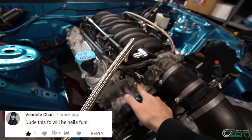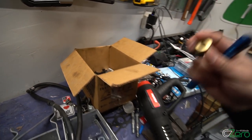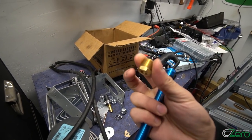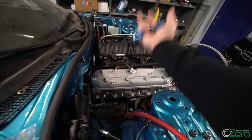Another thing I did was install an aftermarket water temperature sensor here, which will run the signal to the Speedhut gauges instead of the original location. I had a little disaster with this — to install a temperature sender you use a small adapter to go from an NPT fitting to the M15 or whatever the GM head uses. My problem was when I did that, the adapter literally broke in half inside the cylinder head. So I actually had to take the head off, re-tap it, plug that up, put the head back on, drill into the water pump, put a new sensor in, and hook everything up. That was kind of a pain I did off camera.